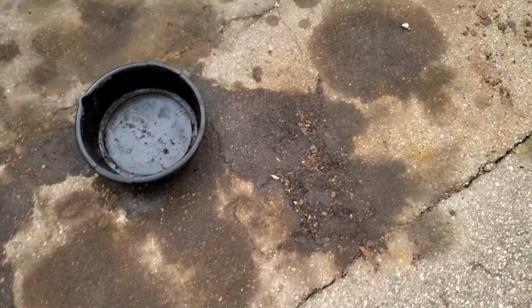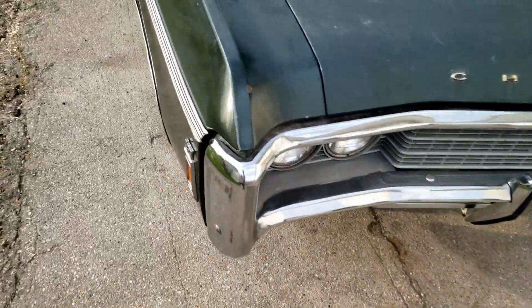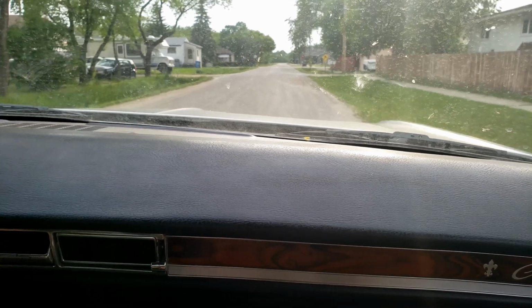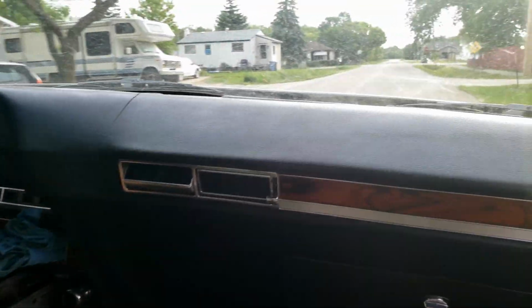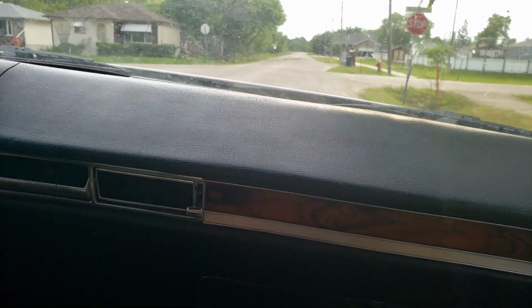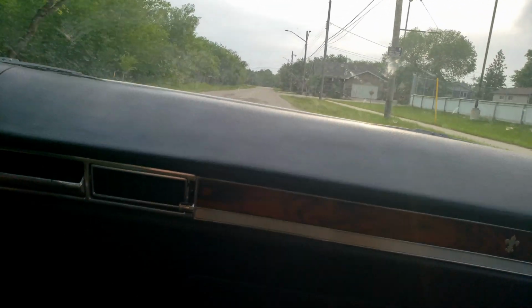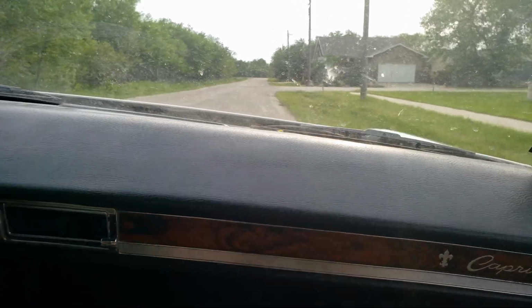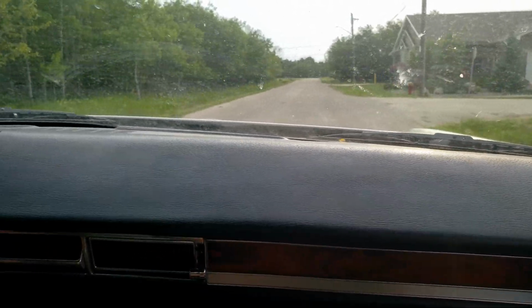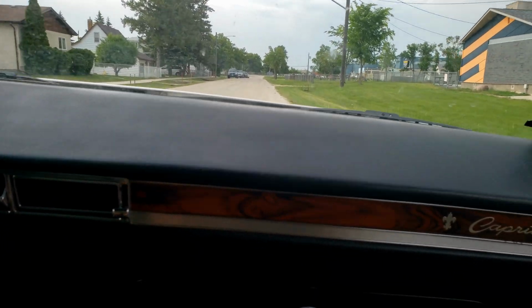Well, it's leaking a little bit, I guess, hey? No fresh drops. She's good to go. This is cool. I think it's fixed. It was just a fuel pump, you figure? I never seen it before, so... Yeah, I think it was. Because it would be like dying right here. Yeah? Yeah. And off the idle it would be dying. Even just when it's sat? Yeah. It was inconsistent, eh? It was probably like, you know, maybe barely on the cusp of filling up the bowl, and then like...